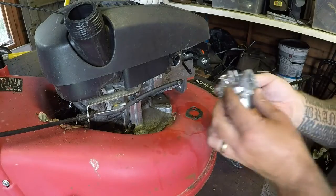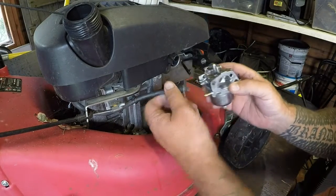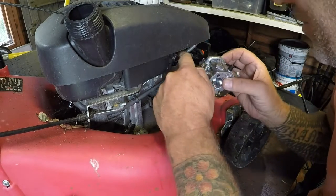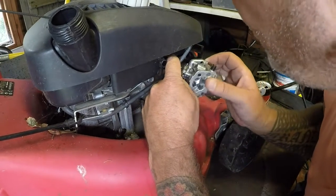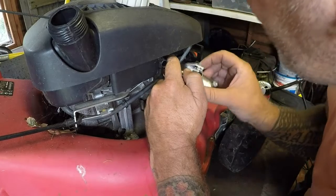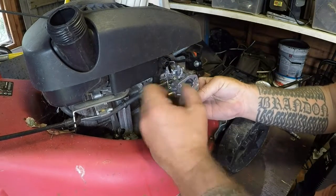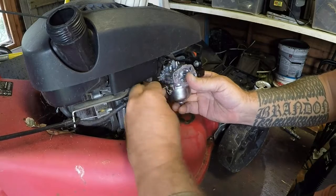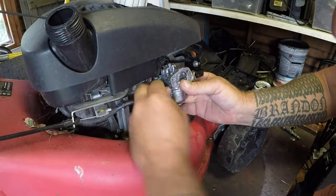Here's a carburetor. So I want to hook it up to the main throttle arm first, which is only one hole. It goes on top of the carburetor flap, so that's on, and it rocks into place then. Fuel pipe on, with one of my silly little clip things I don't like.